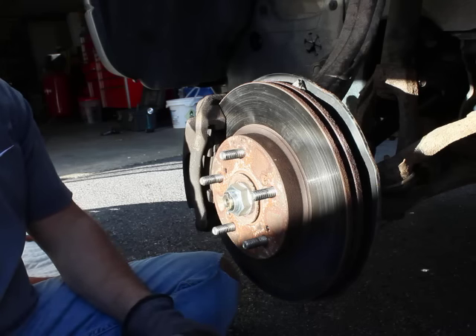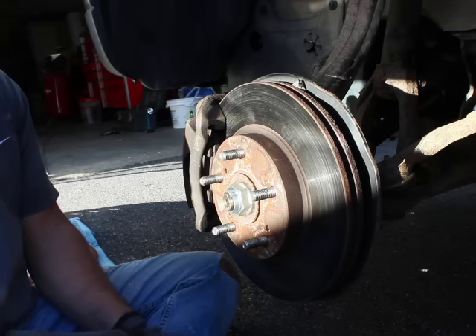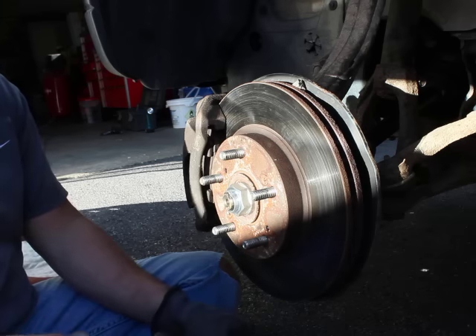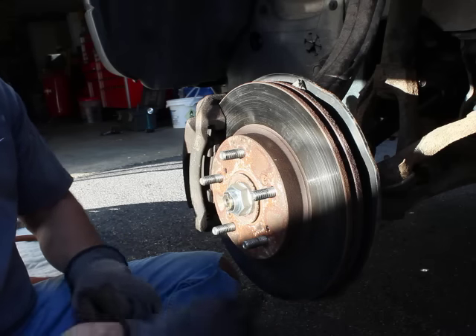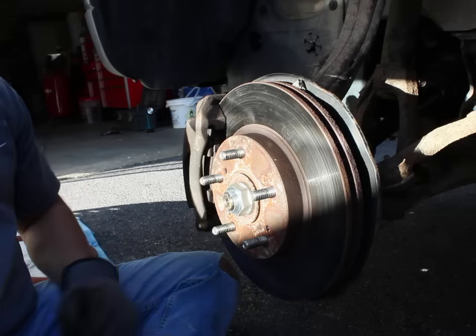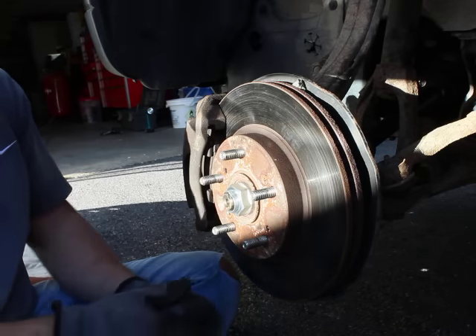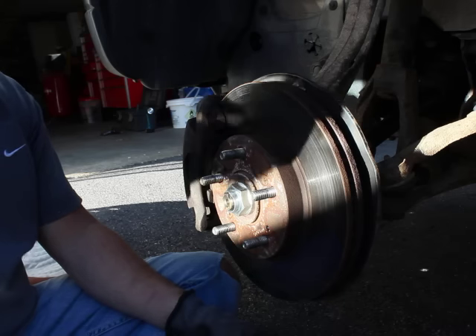So think about it — once you start hearing a noise, did you just drive down a dirt road or hit some freshly filled potholes? That's a little tip to maybe answer some of your questions about scraping noise while driving. If you haven't had your brakes done recently, check your brakes. But if you just had them done, it's possible the backing plate is touching your rotor — just push it away. I hope this helps. If you have any questions or comments, leave them below and I'd be happy to answer them. Take care.